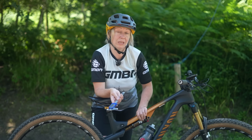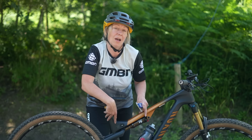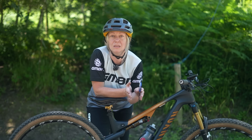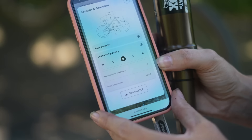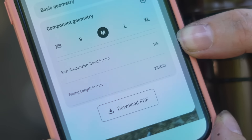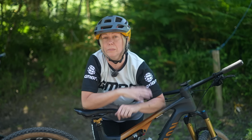You can actually do this with the eyelet measurements as well — measure the eyelets fully extended, then let all the air out and measure again; the difference is how much stroke your shock has. It's much easier to go and find the technical specs for your frame. Sometimes they separate the numbers in a chart and sometimes they put them together, so it might say 190 by 50, for example — that's the eye-to-eye length and then the stroke length. Usually the eye-to-eye is the bigger number.